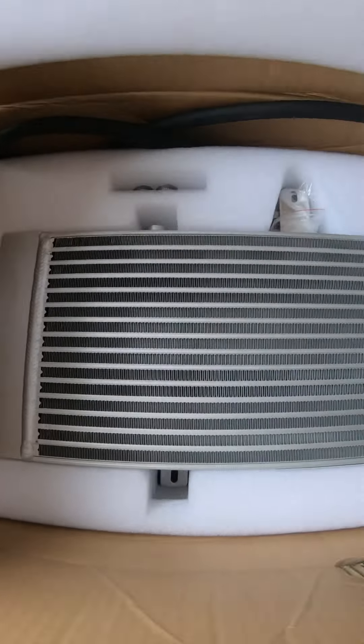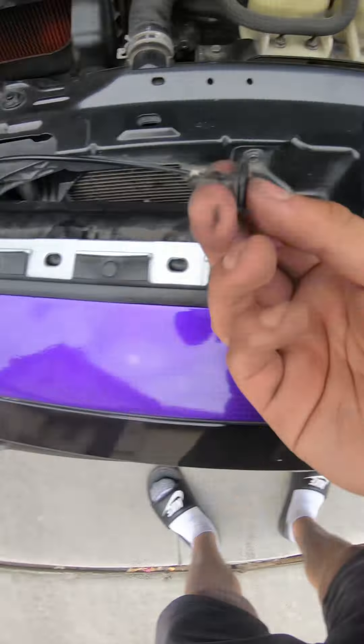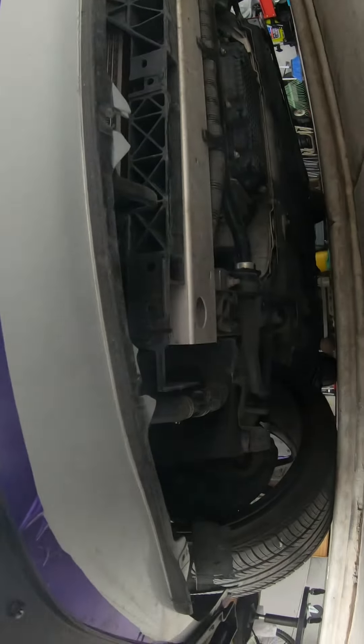So I'm currently about to take off the bumper right now. It's really just direct-on bolts that hold the whole bumper up. You have a 10mm right underneath here, another 10mm on that clamp right there, another 10mm underneath the other side, and then you've got these plastic pieces that you just pop open — I just use a flat head screwdriver. And then right underneath here you've got another 10mm up here too.